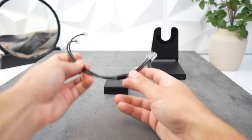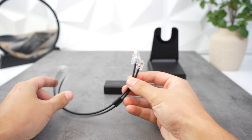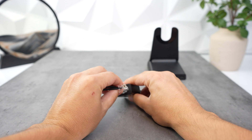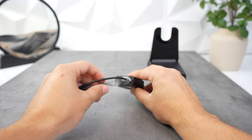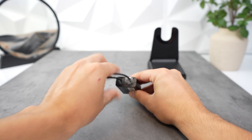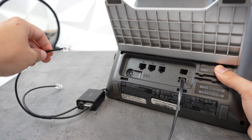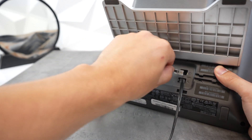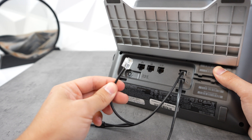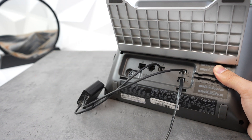When connecting to a Cisco phone, find the cord that has two cords on one end and two cords on the other, joined together. Take the side with the Ethernet connection and plug it into the EHS-62, then connect the other end into the only port it can go into. Then on the other end of this cord, you'll see two cords that look very similar — one is an RJ-9, which goes into your headset port, and the other goes into the Aux port. And that's it, you're set up.